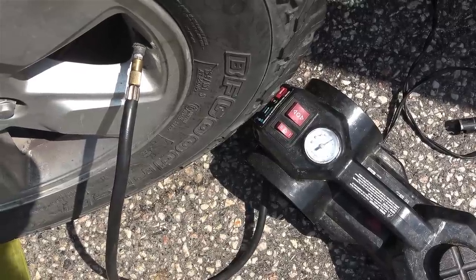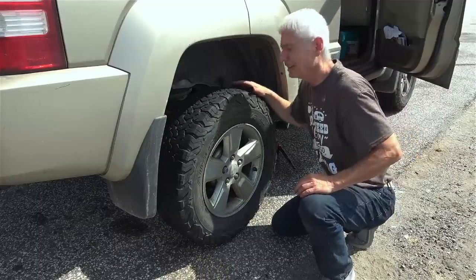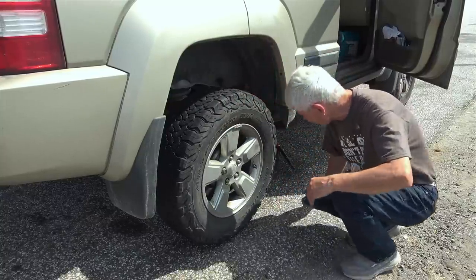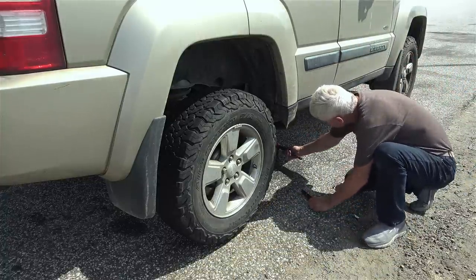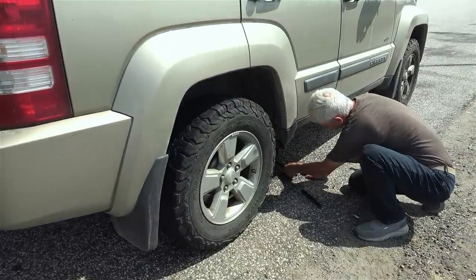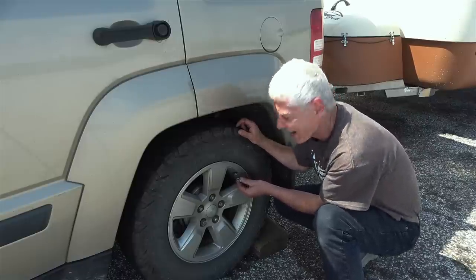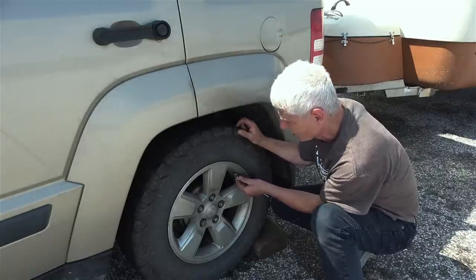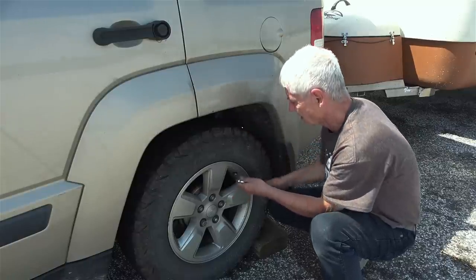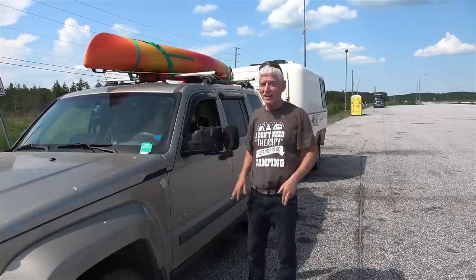With the leak plugged, I now brought the air pressure up to 35 psi, just enough to safely drive on the roads. Well, there's no more hiss. I think I got it. Time to let her down. I'm letting air out in the other one so they're about the same pressure, 35 psi. I want them to be balanced. Hopefully that'll do it. On the road again, fingers crossed.